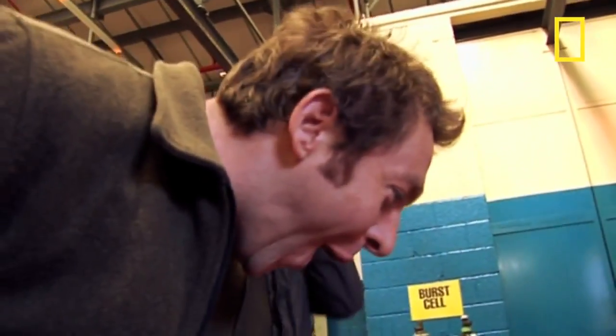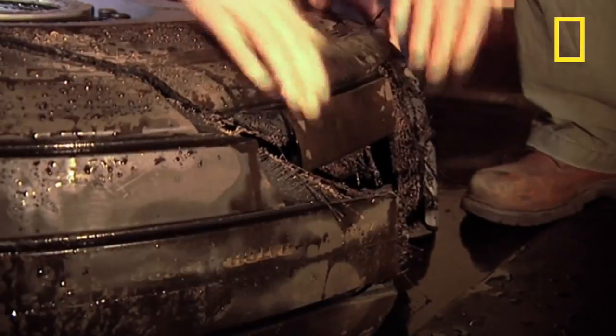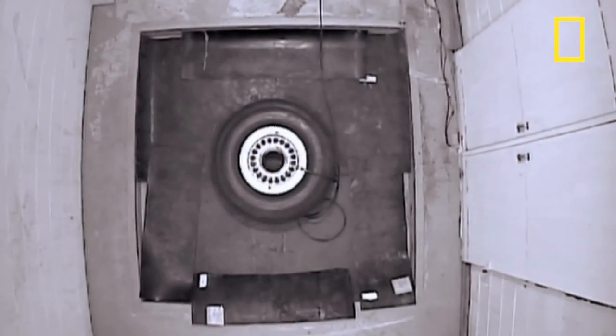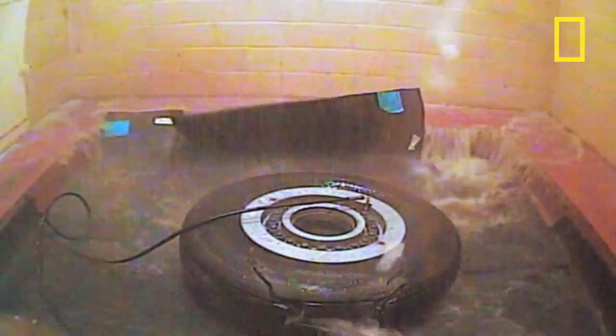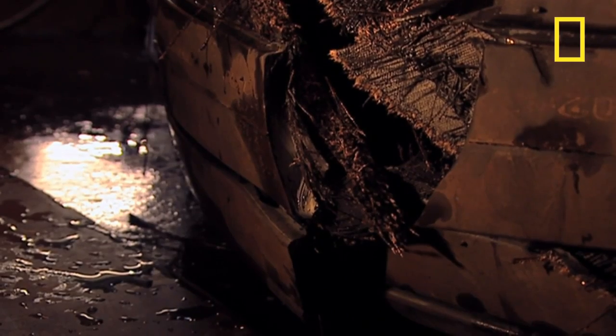Blimey! Richard may have missed it, but you won't. Nick, what pressure were we at? We were at 905 psi. Would you like to go in? Wow, look at that! Destroyed! That's a typical burst that happens on cross-ply tyres. By reaching over four times its normal operating pressure before bursting, and even then still retaining its basic form, this type of aircraft tyre has proved that it has the strength and integrity to cope with extreme situations. Very reassuring in the event of an emergency landing.